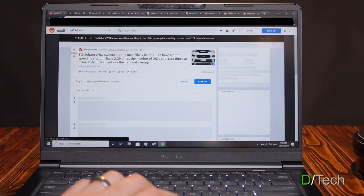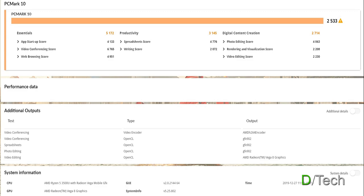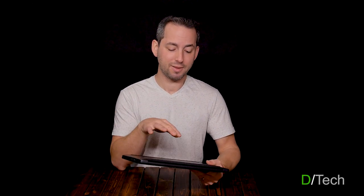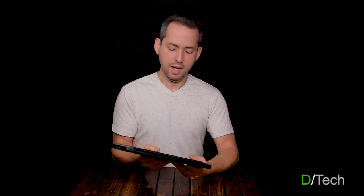This is not supposed to be really a gaming laptop, so if you're into gaming I don't know why you would be looking at this to begin with. That said, people report getting 16 gigs of RAM working just fine in here, and it seems to be limited to 2400 MHz.